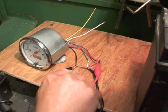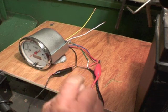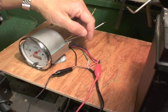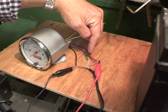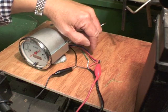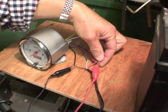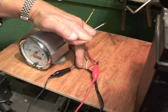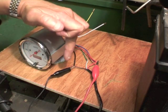Right, so here's the wiring. This is the black, the white and the red from the speedo sensor. And these are the colors coming from the back of the speedo itself. We've joined the red and blue together — because the red is the permanent live and the blue is the ignition live — we've just joined them together for this demonstration, and joined them to the red on the speedo sensor, and all three to the positive of the battery. There's the black from the speedo, joined to the black of the speedo sensor, and off to the negative of the battery.